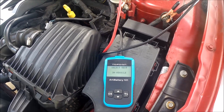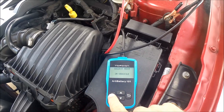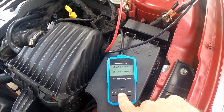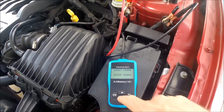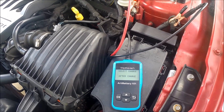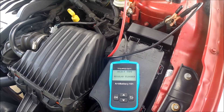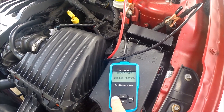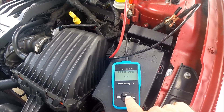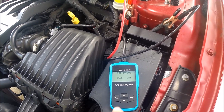Select language: English. Vehicle test — yes, the battery is installed in the vehicle. Select state of charge: after charge, since I've been running the car — I just got back from a 32-mile drive, so it's charged. Select type: it's a regular flooded lead acid battery. Select input CCA: it's 650 amp CCA, which is what's on the label of the battery.